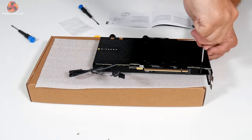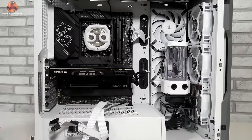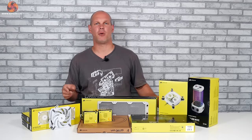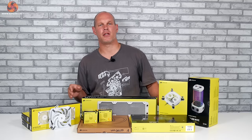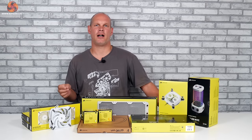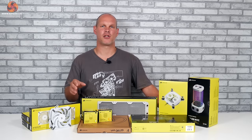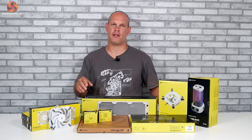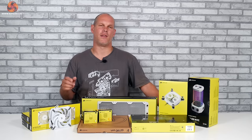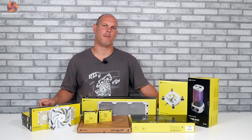The XG7 block comes with a full backplate. With the card ready, it's time to get it fitted back into the 5000T. If you're putting together a soft tubing loop I'd recommend planning it out first — personally I used to draw all my components on a piece of paper, circle where I need a fitting and what type it needs to be. It's a great visual aid and lets you count up how many fittings you need. Do expect to sometimes place a second order — it happens even to me now.